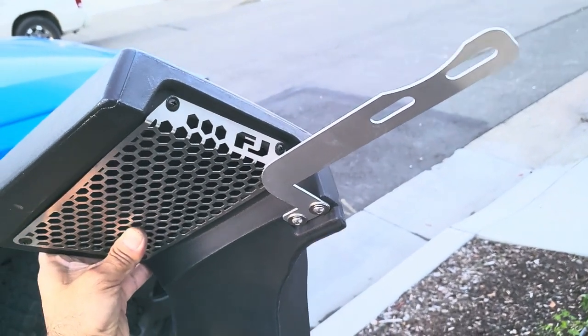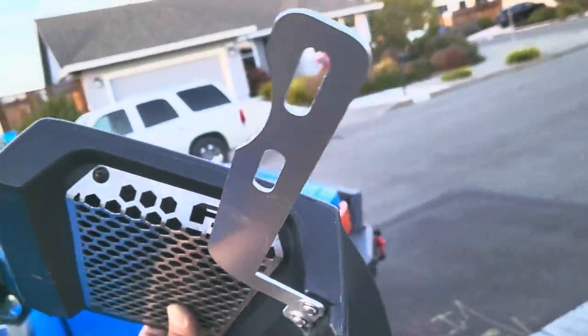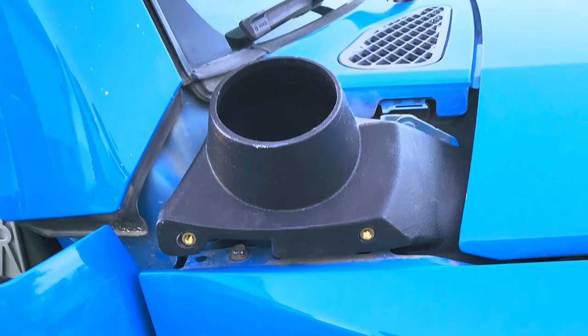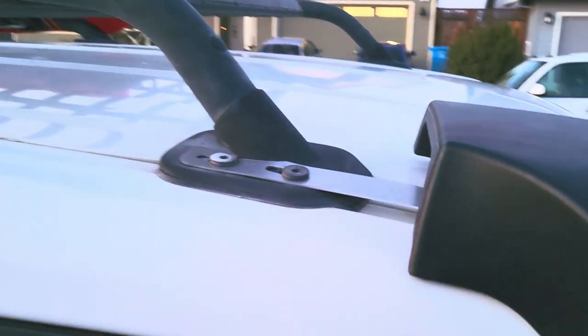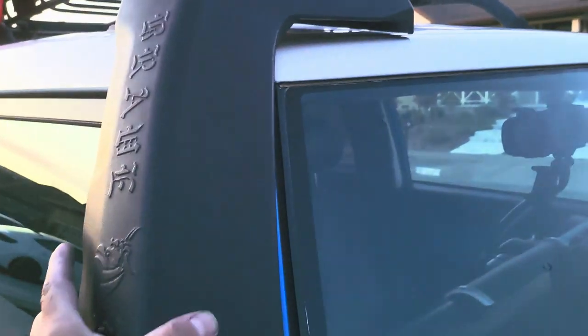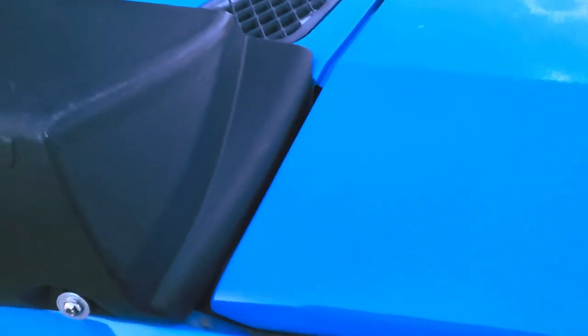I put these brackets on — it comes with a little mesh and self-tapping screws. This little bracket is gonna slip under the roof wrap which I already loosened up, and then the two bolts down here are just gonna screw in right there and that's it. This bracket actually grabs it right there — a little bracket so it doesn't rust. It's nice and snug, I think it's not going anywhere. No drilling required, unlike other ones where you normally have to drill onto the pillar trim piece. When you open the hood it clears — it's close but it doesn't rub at all.